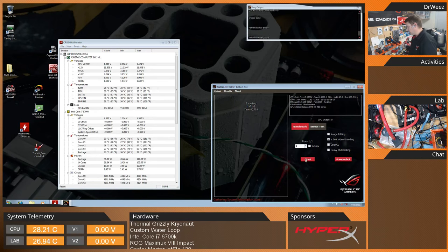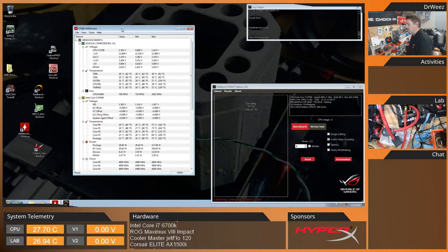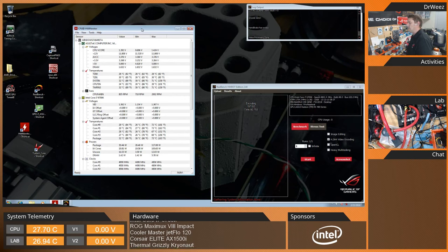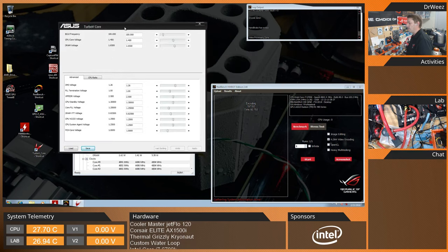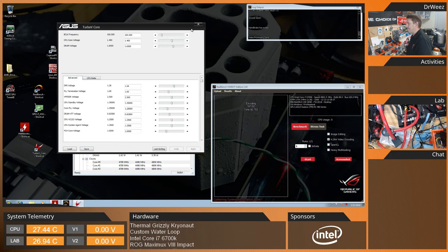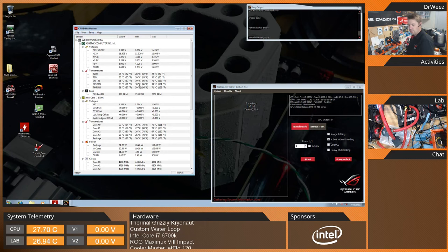Right, so just doing a little bit of efficiency testing there on the CPU cache. And it definitely seems to be better at 46 than it was on 47. That also could be voltage related as well as clock related. So there might be an efficiency ratio between 4.8 and 4.6, whereas the cache ratio too close to the CPU ratio could hurt it. So we'll have to just do those tests again once we find our happy place for clocks today.